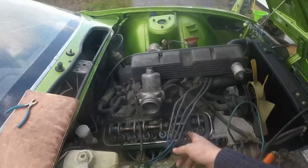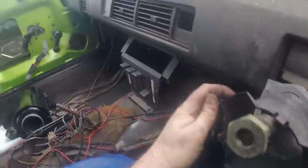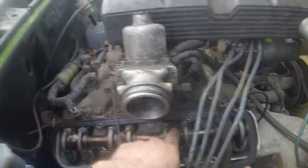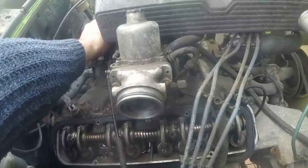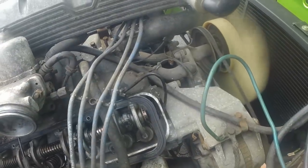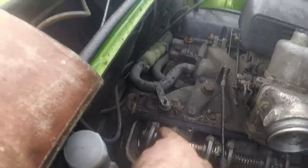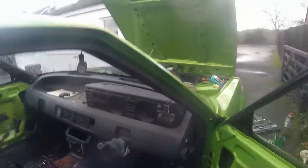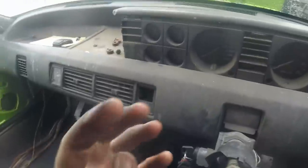Great success — she's a runner! I pulled the cam cover off to double-check I was actually getting oil coming out through the rockers. The alarm isn't working, but off the key there's definitely oil coming out of the pedestals — it's definitely getting oil pressure. I think the only reason it's not showing on the gauge is because the gauge or the sender itself is faulty.